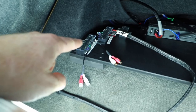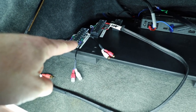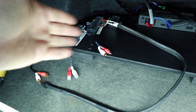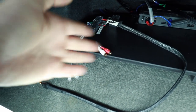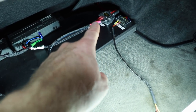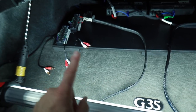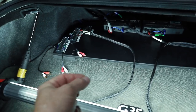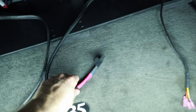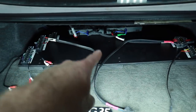Inside the car we have the output from the factory G35 radio using high-level input. Speaker wires are connected on barrier strips for easy swapping. We have our two test amplifiers permanently installed, along with grounded power distribution, accessory ground, and remote from the radio. We're adding new wiring for the input, using the two-channel input mode, and we've added 8-gauge wire to the factory plug.